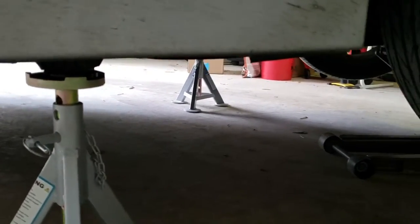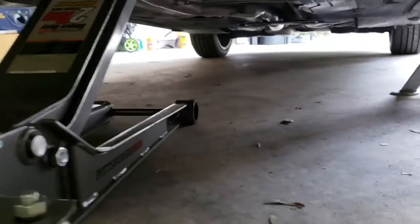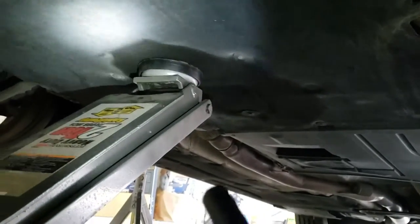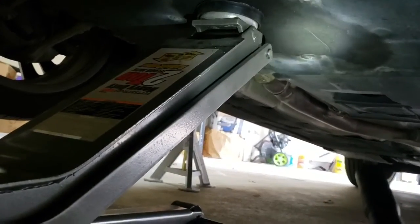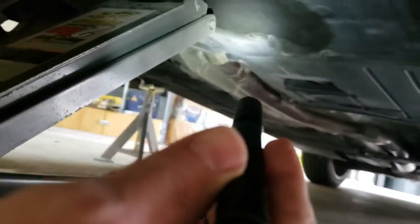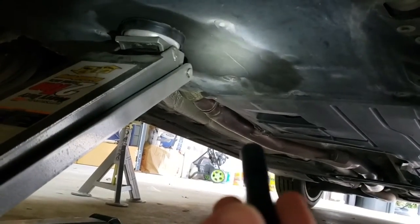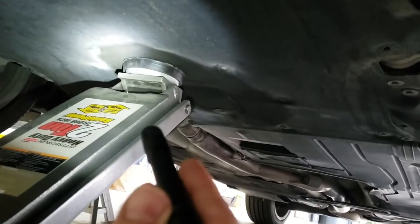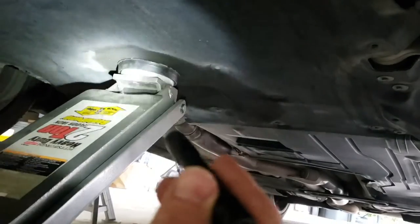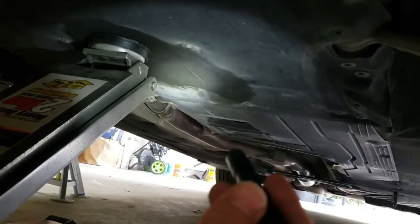There they are — nice and in there, not messing up the plastic pieces BMW puts under there. If we go underneath the car, we can get a better look at that area where the jack goes. Now there's this indentation here — there's one bolt and there's the other bolt. That's about dead where you want to put your floor jack. If you see behind there, that's actually the door to the drain plug, so you don't want to put your floor jack on that for sure. If you're back there, you've gone too far. Good mindset is to get it between those two screws. Next we'll get the floor jack out of here and we'll get to draining the oil.